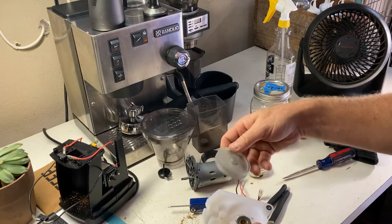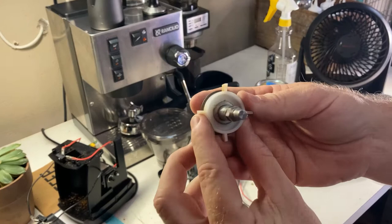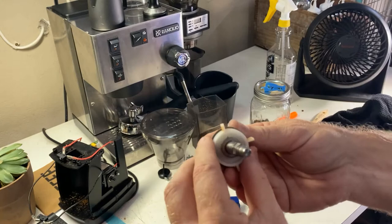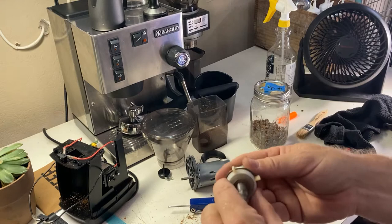This thing is basically just a spinning wheel, so I'm going to leave that in place. And there is the part I was missing before. Basically when this goes bad, you will be missing these little ridges on all four positions and it will just be flat. You'll know because beans will just not grind up in your hopper at all — they'll just be jammed up in the burr area. So that's obviously not good.